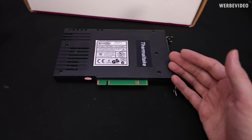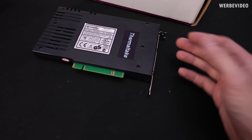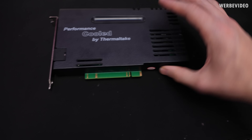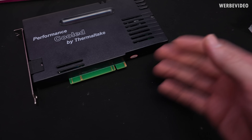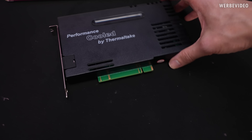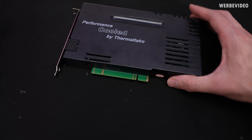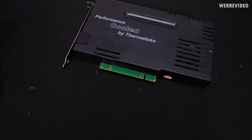Obviously we could also directly connect this to a PSU, just make an adapter with a SATA cable for example and directly solder on the pins or use a PCI adapter. Unfortunately I don't have any PCI stuff laying around anymore and I don't want to solder on this because I want to keep it in its original state. That's why I'm just going to use a second setup for just having the 5V and 12V supply.